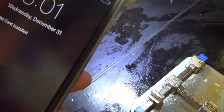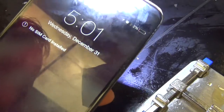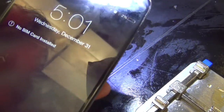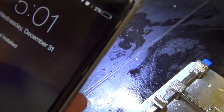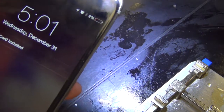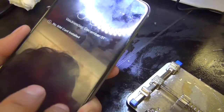Hello, today I'm doing a repair on iPhone 6 Plus — a no-touch issue. I already troubleshot the IC. It's a no-touch problem and the phone wasn't turning on before, but after charging for a really long time I was able to fix the screen problem. It had lines on the screen. Now it's less. This is a common problem with no-touch IC. It gets very severe like this, so you have no touch function. You can see here, and there are sometimes lines — Z-bar lines on the screen.